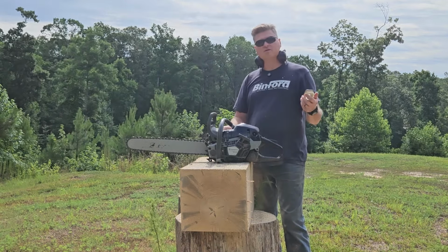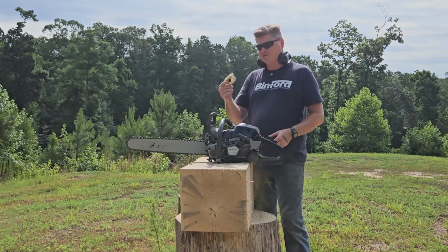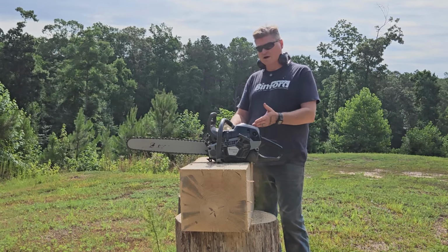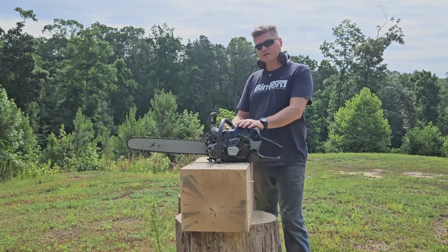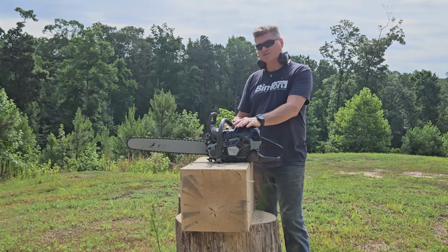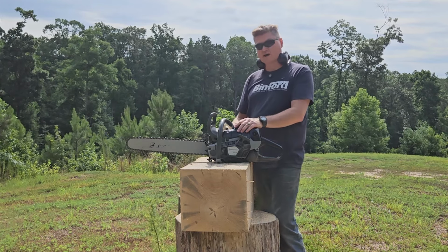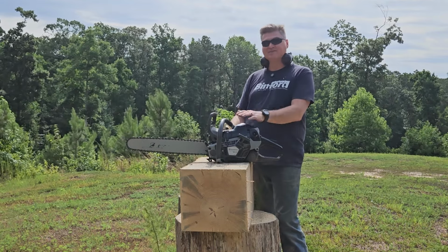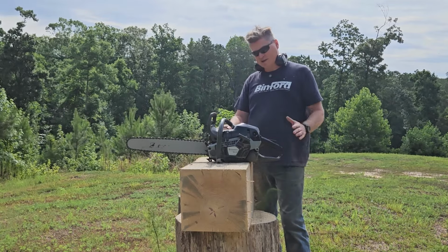My thoughts are, if you've just got a work saw, even if it's ported, right? I mean, on a stock saw, it probably ain't gonna make any difference whatsoever because they're just not breathing as heavily as this. I've done a carburetor mod, it's ported and polished. Big muffler mod, it's flowing a lot more than it did stock. The last test that I did, this saw gained, I think, 42% over stock in power. Now that I've fixed that timing, it's probably more like 45, 46% over stock. And in stock trim, they're already the fastest 60cc saw that there is available. So, you know, really great gains on this saw.